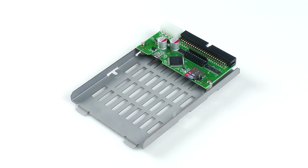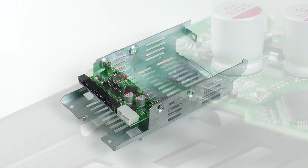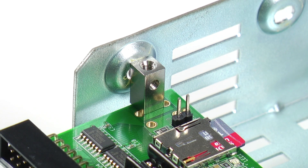So for me the version 5 is the model of choice. I really like the way it can easily be mounted on the same bracket used for a three and a half inch drive — either by using standoffs if it's a bracket that mounts at the bottom such as the Mac 2CI, or by using some sort of right-angle device if it's a bracket that mounts at the sides such as the old Compact Macs. It's small enough and light enough that it only needs the two screws to hold it secure.